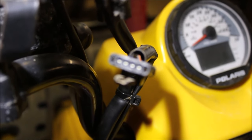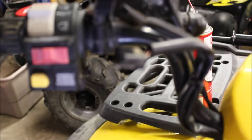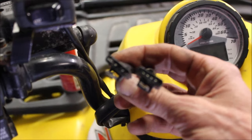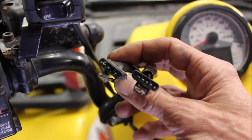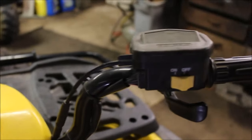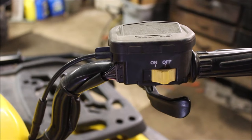I got the wires disconnected — they're looking pretty clean. I'm taking a little piece of sandpaper and rubbing back and forth to clean the terminals off, then I'll grab a can of electric parts cleaner to clean that out. Make sure you let that dry before you plug it back in because that could be a safety hazard. I'll blow it out with a little air. These are looking pretty clean, so I'll put a little dielectric grease on and plug them back in. There's one other quick trick — try putting an extra ground wire on that speedo to get it to work. If that doesn't work, the speedo's probably shot, and I'll show you my trick to get the four-wheel drive shift indicator lit up and working.